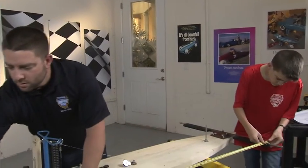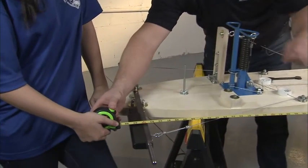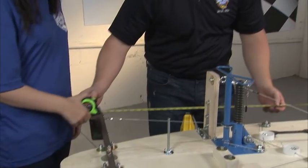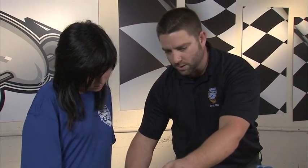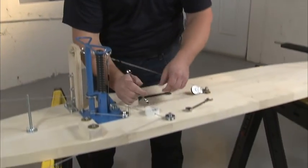Hook it over the back axle. That's at 63 and a half. I like having you up front so you can look right down on the tape measure and make sure that we're being precise. Now let's go to the other side — make sure that our steering wheel has stayed centered. It sure has. We are off — we're only at 63 and a quarter here, versus 63 and a half over there. That means we need to increase the tension on the left side of the axle, which is going to pull the axle back a little bit. That eighth inch can get us into alignment.